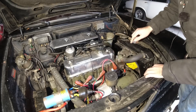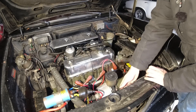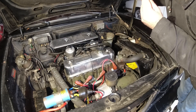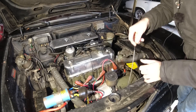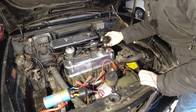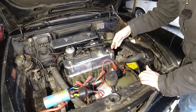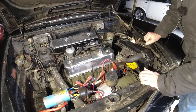Yeah, that moved freely. I felt the bottom crank move. I just put some pressure on here and pulled on that fan blade. Make sure we have some oil in it - and we do. Smells old, but not excessively fuel-y at least. Looking in here - nice and clean. You can see the top of the valve train. It's a push rod engine, so you have little rockers in here.